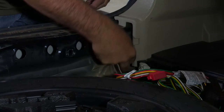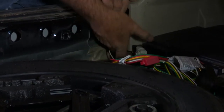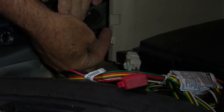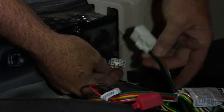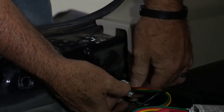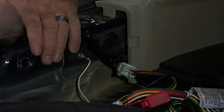The last thing we need to do is just plug it in. We're going to reach behind here and grab this harness, tug on it a little bit, and reach under to grab our plug which is right here. Then we're going to take the aftermarket plug and simply plug it right in — it snaps right into place, just like that. Now our tow harness is activated.